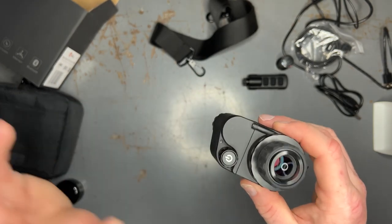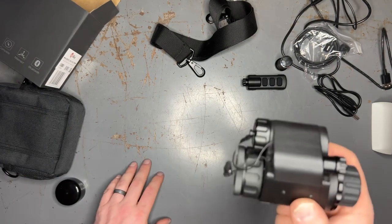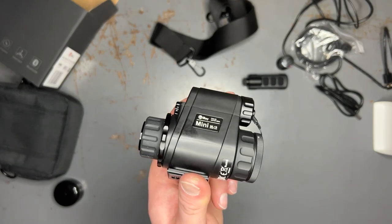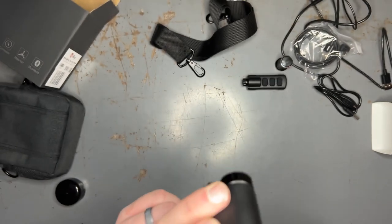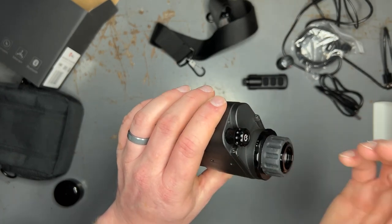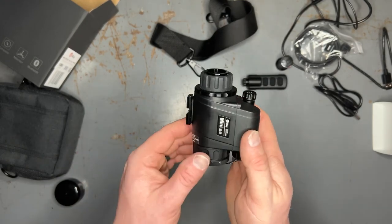If you push and hold it's going to turn the device on. Once the device is on, a short push will access a menu within the device where you can change the brightness, color palettes, and access different modes. You can also do the NUC — however you pronounce it — which resets the thermal calibration to the environment it's in. A long hold will bring up the main device menu where you can access contrast, compass calibration, picture-in-picture, and everything else you'd want. It works really, really well. For $2,500, the form factor and usability you get make this thing a home run — it's pretty unmatched for thermal monoculars in that $2,500 range, and the quality of the picture is just absolutely stunning for that price.